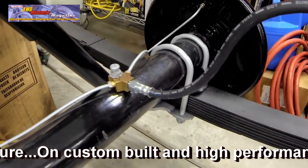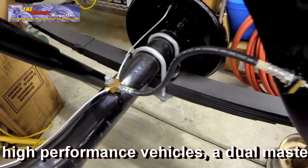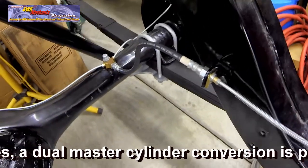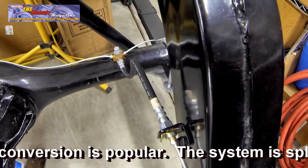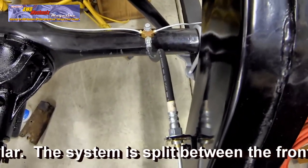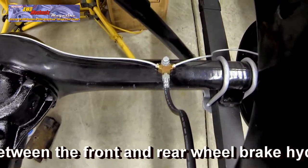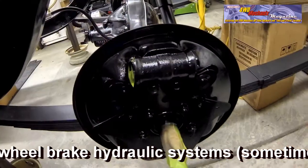Note that the routing of the hose is also careful. There are no twists or wrinkles in the hose. As the axle rises and sets, the hose must clear the frame. This is the proper routing of the rear brake hose. The Y-shaped T is also factory — that splits the rear brake tubing into a left wheel and right wheel approach.